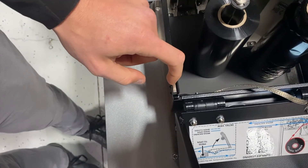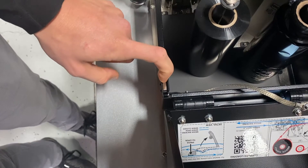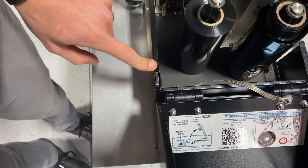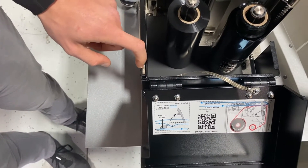When that switch is pressed down, and you can hear it click, it'll tell the Zebra printer that the cover is closed and we're ready to roll. If that doesn't make contact, you're going to constantly get an error condition cover open. Just be familiar with what that sensor is.